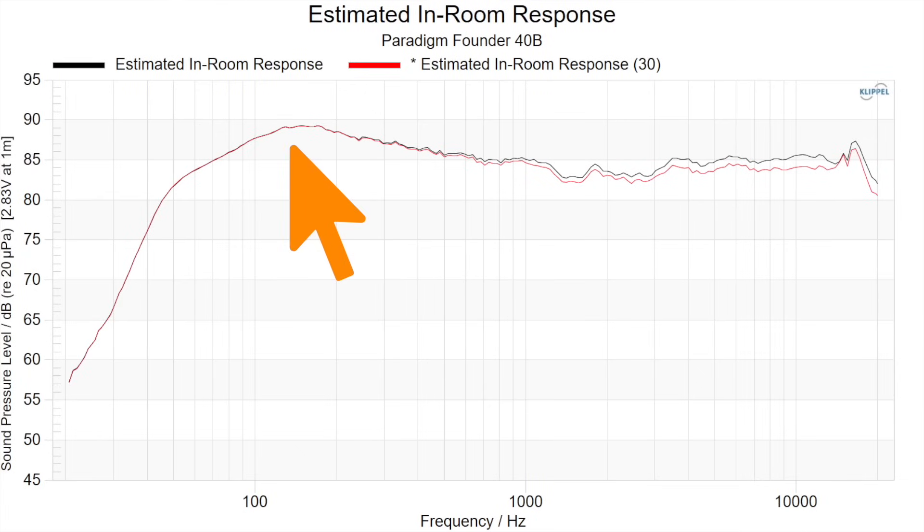When I pushed these speakers closer to the wall, I actually liked the sound more. Some of that may have to do with rolling off a bit sooner, but also I was catching some nasty room modes. When I didn't use EQ to bring those down, it was almost too annoying. This shows us a couple of things: as a listener and reviewer, you've got to consider what's going on in your room — placement relative to where you are drives the bass and mid-bass response. The other thing that may have contributed is that these speakers have a little bit of a bump around 120 hertz, which we'll also see in the data.